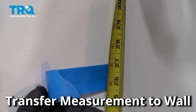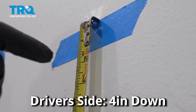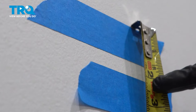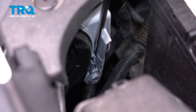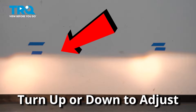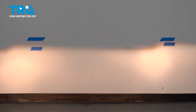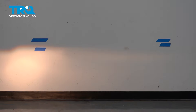Transfer that measurement to the wall, making a mark with some tape. On the driver's side, measure down four inches and put another piece of tape. For the passenger side, you only need to measure down two inches. Now turn the headlights on — it's easier to do this at night or in a dark area. Locate your headlight adjuster and using a Phillips head screwdriver, turn the adjuster one way or another to bring the headlight up or down. Once the headlight is adjusted to the tape mark on the wall, move on to the next headlight. If you're confused because the beams seem to blend together, you can have someone stand in front of the other headlight while you make your adjustments. Now your headlights are aligned and you're all set to go.